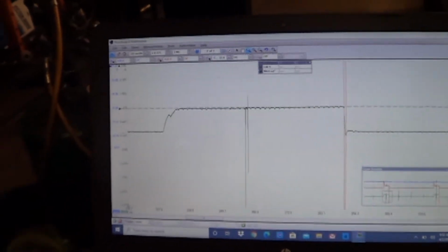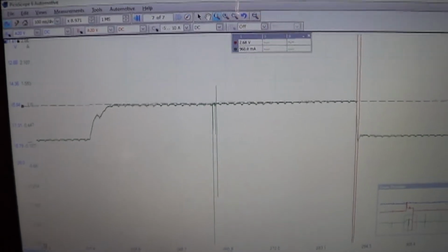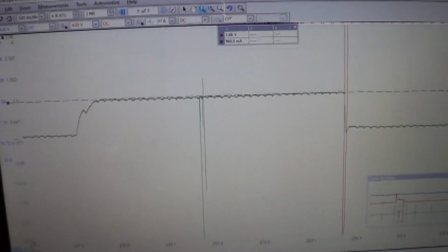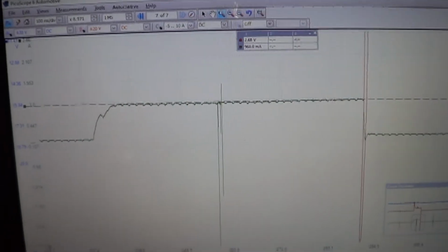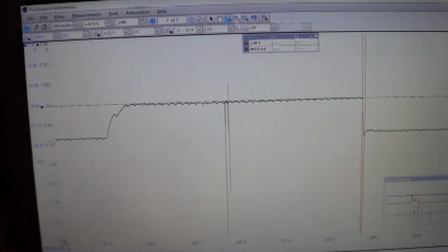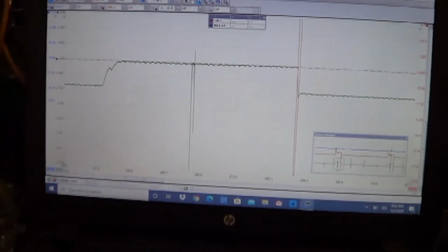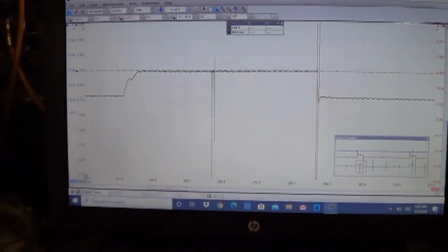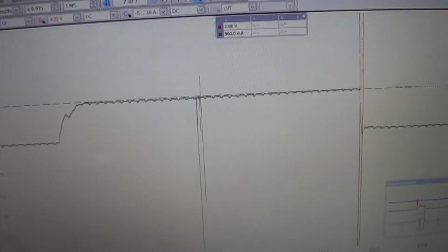So we have fuel pressure, we have spark, we seem to have a working fuel injector, so why won't it run? It's kind of a mystery to me. I've been standing around scratching my head, not knowing what to do with it. Now remember, this thing would run with starting fluid. So I guess when we figure out something, we'll take some more video.